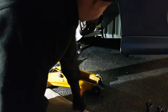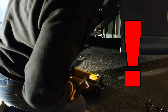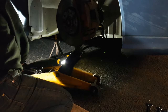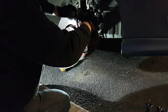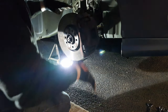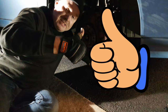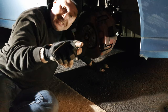It's important to tighten up that bush in its normal operating position with the weight of the car on the suspension. Once you've tightened it up, let the suspension back down - basically the bush should be in its relaxed position when the car is sat on its suspension at its normal ride height. And that's it, all done. I hope you found that useful; if you did get some value from this please give it a like, and I'll see you next time.